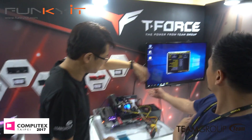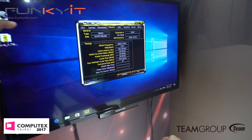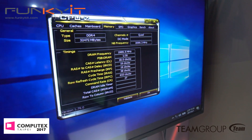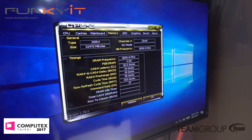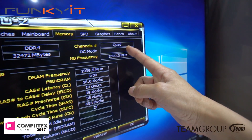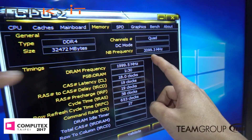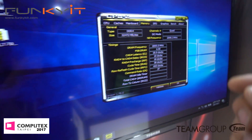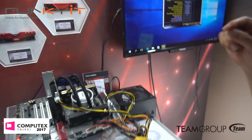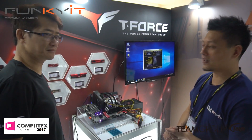Showing up here is from this machine. We know the X99 is able to cross over DDR4 3300. Right now we can see the quad channel — the full 8GB per stick and 32GB here in quad channel — and it goes up to DDR4 4000. Remember, the Intel X99 is not supposed to go over 3000 to 3300, but with this RAM — up to 4000.